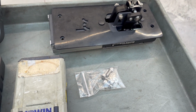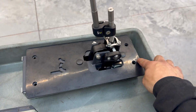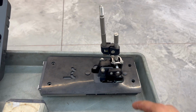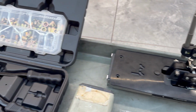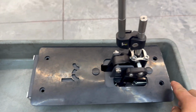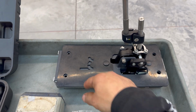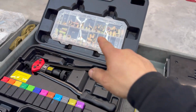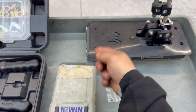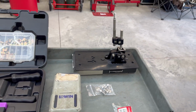Basically, to give you a quick rundown, this is intended for a Honda Civic K-swap. So this bolt pattern is already made to bolt up to the Civic tunnel. Since the bolt holes don't line up with the Mini, the reason why I use a rivet kit is because I'm going to mock this up in place. I'm going to mark these holes on the Mini chassis with a Sharpie, and where these holes end up is where you're going to be drilling and inserting the rivnuts. That way, these get locked into the chassis and you can easily zip the bolts on and off as needed to get the shifter box on and off whenever you're doing some maintenance.